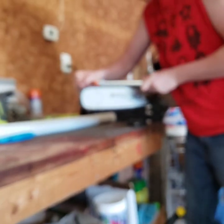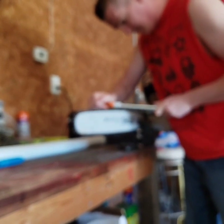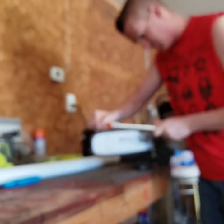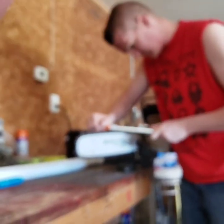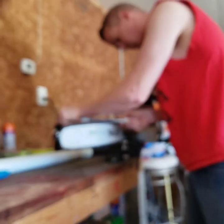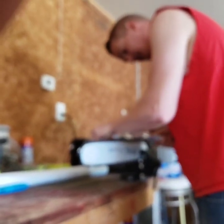And then once you get it on there, grab the phone back. Once you get it on there, basically it's just a process of doing a quick grind motion. Now, the files in this aren't static. They're able to move. And so you only want to grind one way. Kind of same thing with the knife. And this chain is very not sharp. I actually used it to saw into a stump that I'm going to burn. And so it's going to need some work and pressure. But anyway, you just go down the file and you get each tooth.